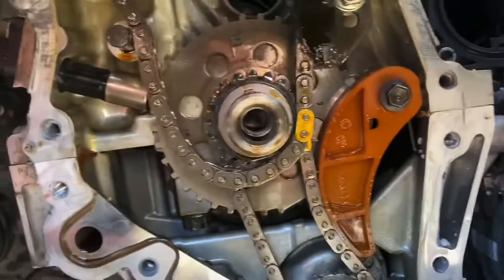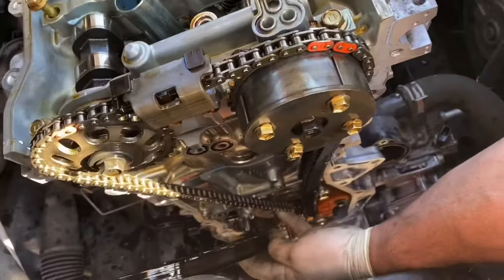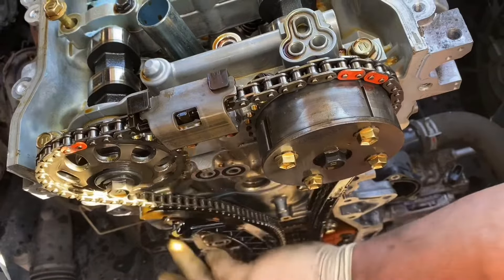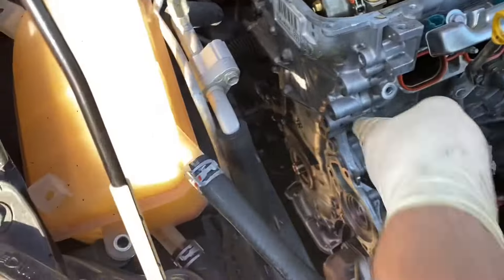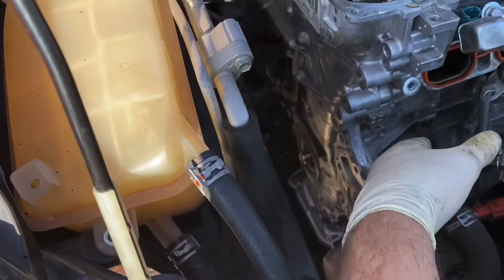As long as those remain aligned, get this little swing arm guide, get it on, get the chain lined up, push it in all the way — it will stay in place as long as you push it in far enough. Next, put the timing cover on and start bolting it back together. Put the 14s, 12s, and the 10 back on and tighten all this back up.